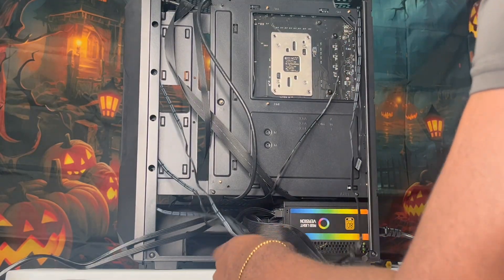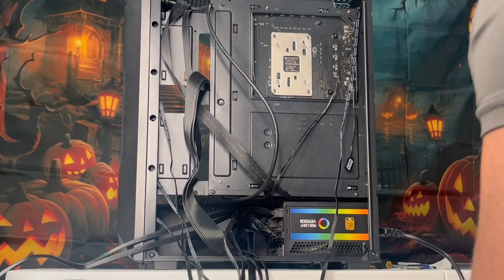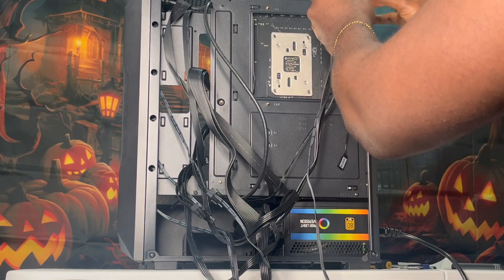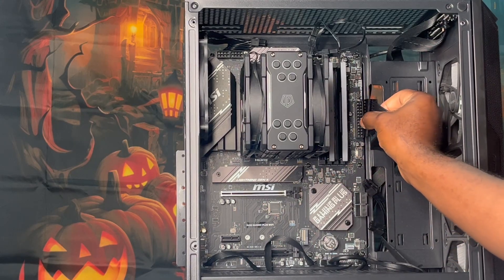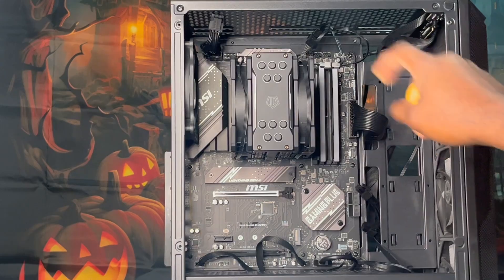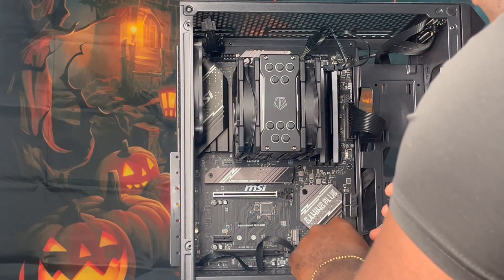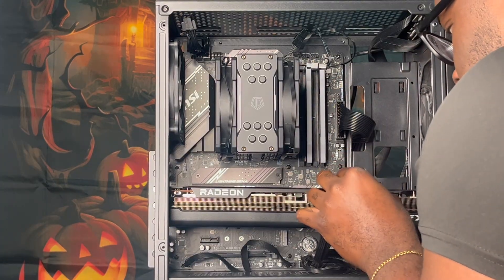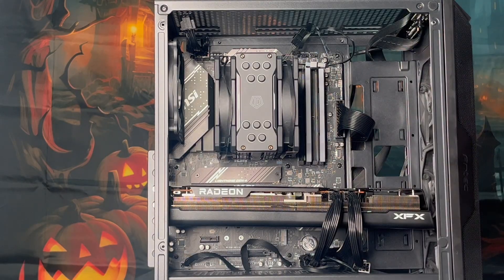Putting these cables through in a normal fashion makes cable management easier in the future. Now we're going to plug the case fans in. The CPU cable gets routed underneath all of this because it goes in the opposite direction of everything else. We're going to take the motherboard cable with the clip side and rotate it this way, then take the CPU cable up here — that clip is going to be up top. That one is super tough to get in so make sure it's really in there. Then plug the PCIe into the GPU clip side up — and that is a complete PC build.